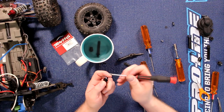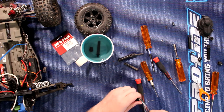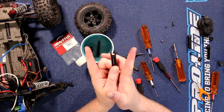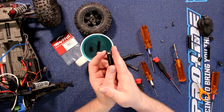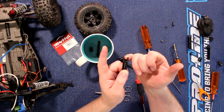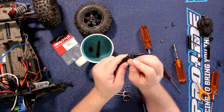You could grab your flat screwdriver and try to pry it in, but what's going to happen is you're going to take these two ears and basically spread them. This plastic in its normal state has a memory — it will remember that it was bent and stay that way, which gives you more issues in the future with the ball coming off. Putting them in hot water will soften the plastic, help you spread them, and it will come back to its original shape.